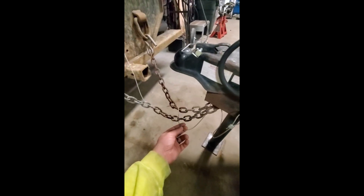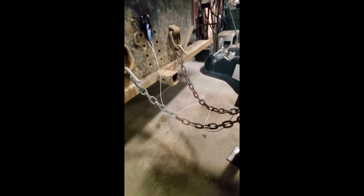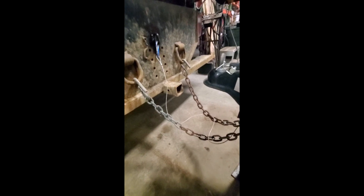When I say it can't be wrapped around any other object — one common mistake we see out in the field is that because these cables sometimes get too long, it's easy to just wrap them around the chain to try to keep them from dragging on the ground. That's going to result in a violation as well.